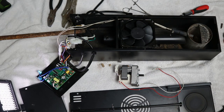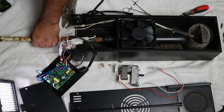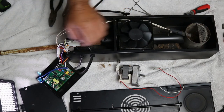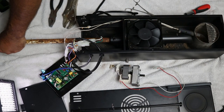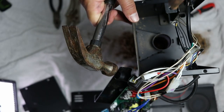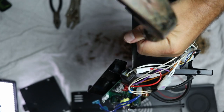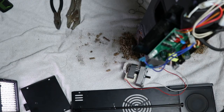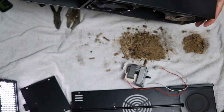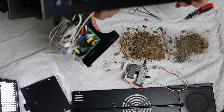Now is where you have to dig around the house and find something that will fit in the auger tube that can break loose the jam. Just make sure whatever you use is safe — or at least safe-ish. I had an old railroad spike and a hammer. I ended up setting the unit on the end and hammering the spike down through the jam until it broke loose. Once loose, I dumped out the junk, and there you have it. That pile of crap is a nice reminder to always cover your grill when you're done.